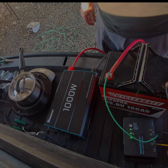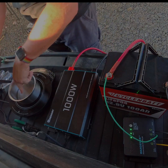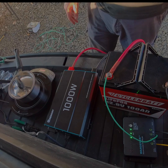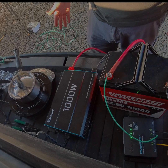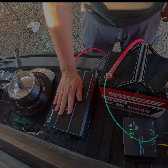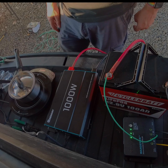If you look over here, the PV button - which is our power feed - is live, so we are charging the battery. We are heating up water over here. I forgot to hit start - there we go. Just out of curiosity, I'm going to see what happens if I put it up to 1300 watts. Everything seems to be still going. I believe this Renogy is able to burst up over 1000 watts briefly, but we should probably keep it at 900 watts most of the time. That's why I didn't buy an 1800-watt cooktop.